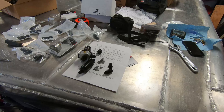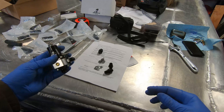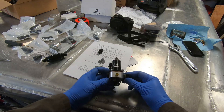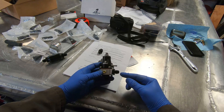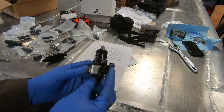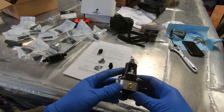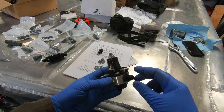Welcome back to the airboat build. Today I'm going to do some more work on the fuel system. I have a bunch of dash-6 fittings and the main goal is to modify the 5.3 LS fuel rails to accommodate using an external fuel pressure regulator — an Aeromotive boost-referenced fuel pressure regulator. I'll be applying boost, starting at eight pounds, and I want fuel pressure referenced to boost.